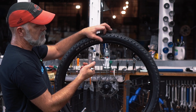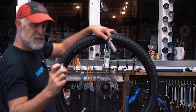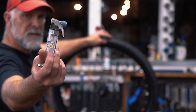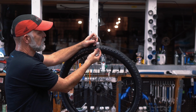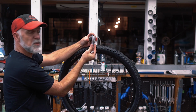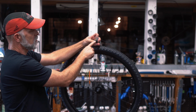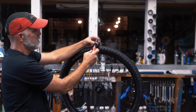And then this is a multi-inflator. This can actually do a threaded or a non-threaded canister. If you can see this guy right here, this is a threaded canister. There's threads on there. If it's non-threaded, you have to use an inflator like this that has a bottom part to it. So if this was non-threaded, we would be putting this in there and threading it up, and this would put the pressure on to puncture. Most of these multi-use heads are actually threaded inside here, so you can use a threaded canister inside here.